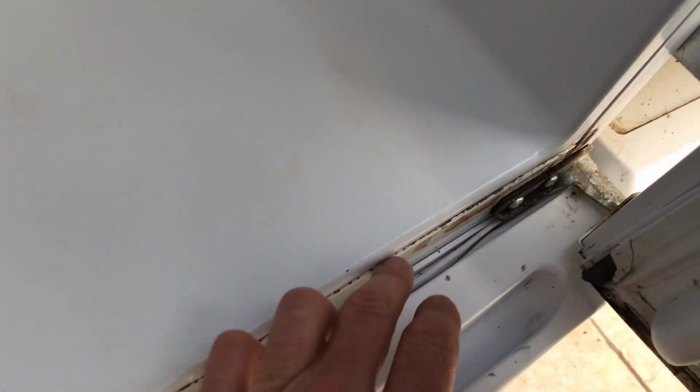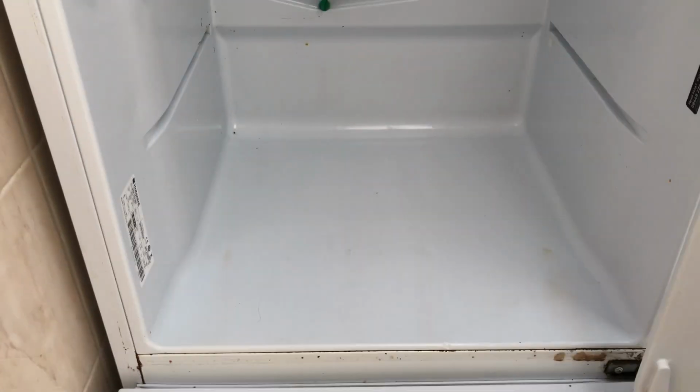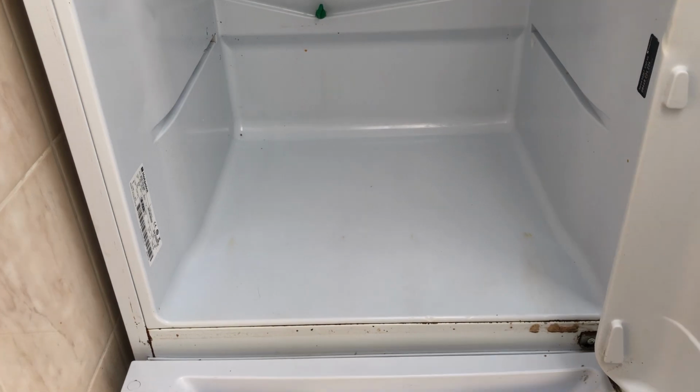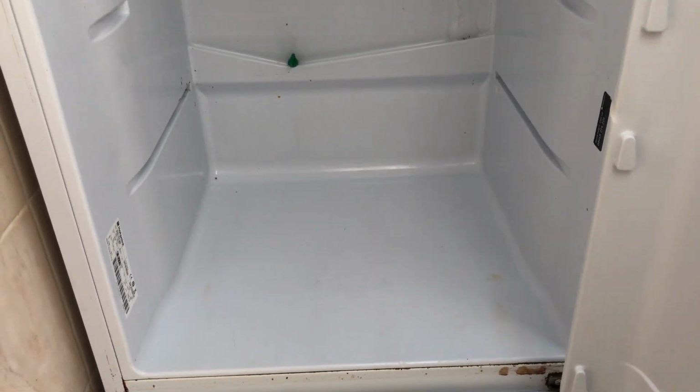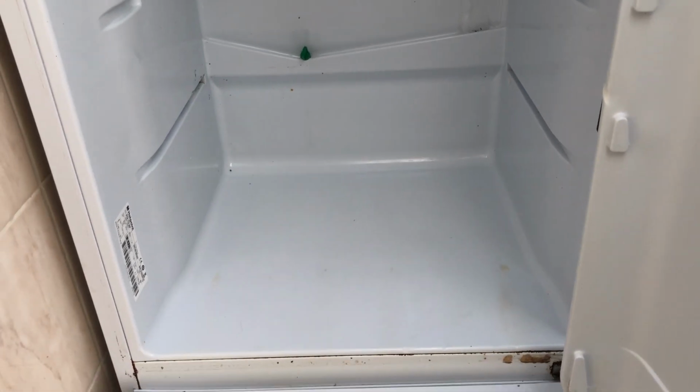You're also supposed to put a little bit of grease up the right hand side, so up this edge of the fridge and the freezer door. However, if you use petroleum grease, it will erode the rubber of the seal, so you need to use silicone grease. I'll put a link to some in the description. It's a little bit more expensive, but it will not ever rot rubber. It's well worth having a tub in your toolbox. The point is, you've probably tried the seal.